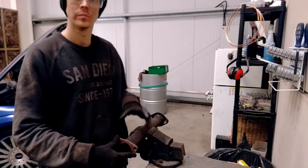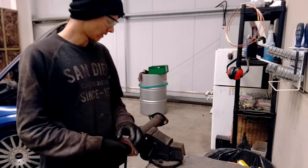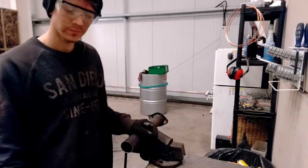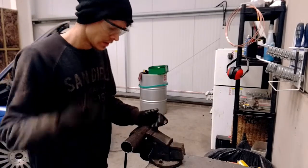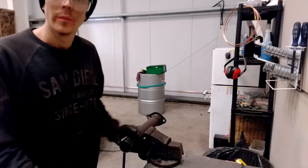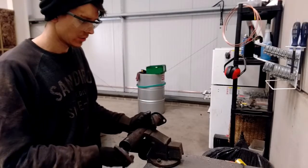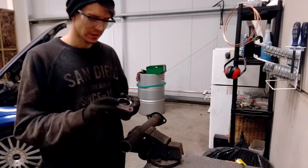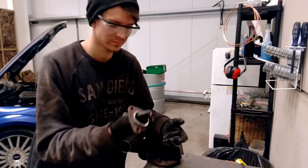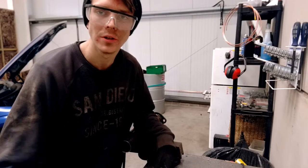We need to know exactly what orientation this needs to be in. So we're going to bolt this onto the car, bolt that onto the car, and then we'll make some tack welds with it on the car so we know it's in the right place. Then bring it back over here and weld it fully. Just got to clean up the surfaces ready for welding — even though we're only tacking it, the same applies: always clean the surface before welding, because you can't just weld to rust. Rust doesn't conduct properly — it'll ruin all your hard work.